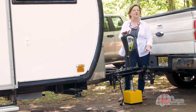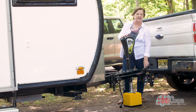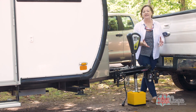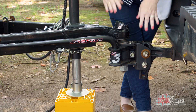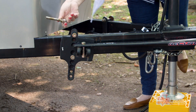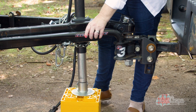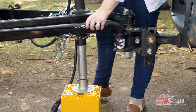I'm traveling with my weight distribution bars on, so the first thing I want to do is raise up my hitch here to take the pressure off those bars. I am leaving my coupler down until I get my weight distribution bars off. I use the R3 Recurve Ease Lift weight distribution hitches — these are a dream for girl campers. I had a different kind before that had to be shoved up from underneath and I didn't always have the arm strength needed for that. These drop in from the top. There is an easy safety pin — you push a button and pull it straight out — and it's on a wire so you can't lose it. If I raise it up high enough, I shouldn't even need the tool to get it off — it should pop right out, but there is a clever little tool. You can see this is relieving the pressure from the bars and it's going to slide right out.